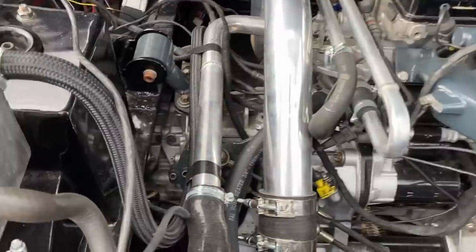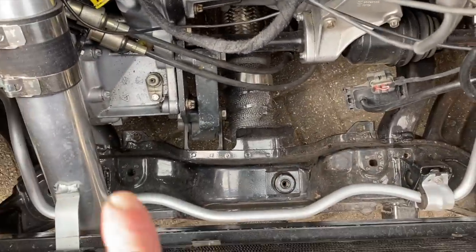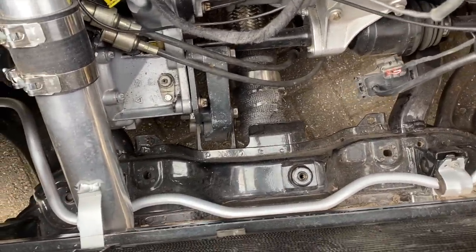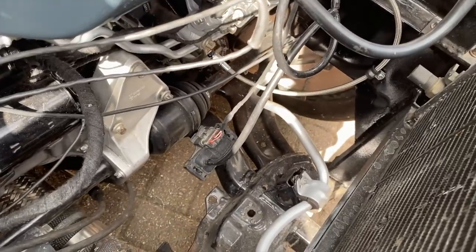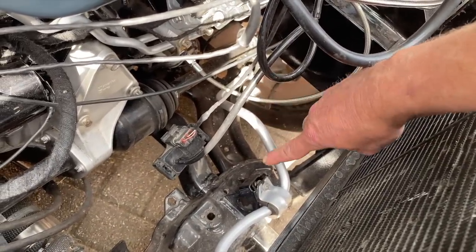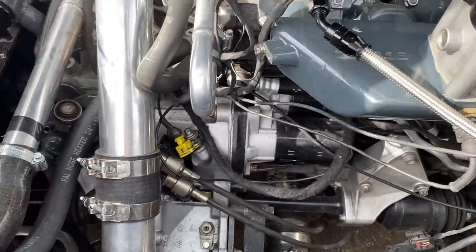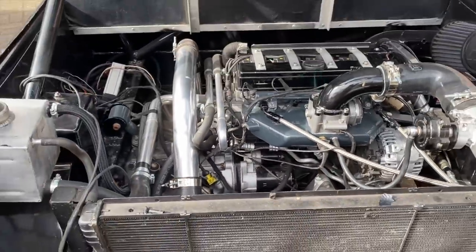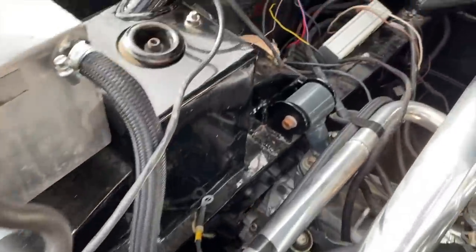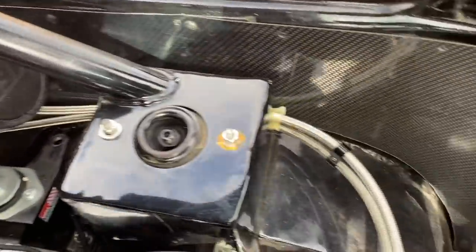It's on an F23 box with a diff cable shift — hence why this should get a VX220 shifter. As you can see, the boost pipes run to the back end. There's the standard Corsa-C subframe, and as I said earlier, this is why it's determining the width of the car, because it's using standard Corsa-C bottom arms. The owner tells me the actual car width, edge of wheel to edge of wheel, is six foot — which is surprising. So that would mean the Nova is around five foot. Box section, space-framed on the rear.